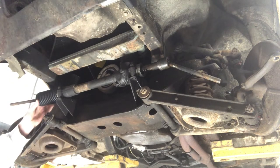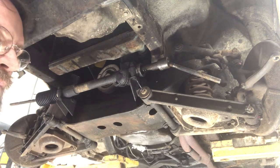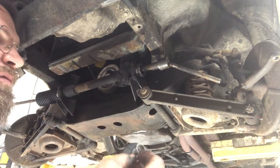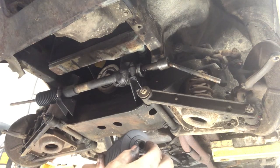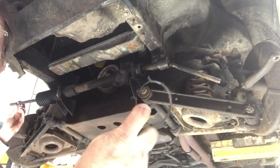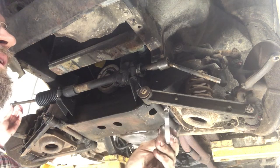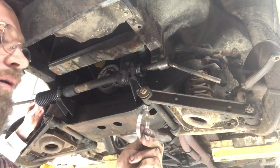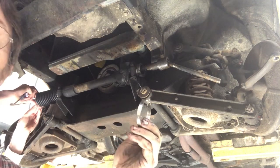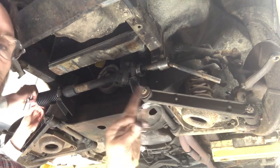The new ones can come with a variety of different clamps over the years. Sometimes the clamps are the same style but maybe a little wider — in this case on the end here, this is actually a fuel line clamp for a fuel injection hose. It's just a little bit wider, so you've got to play with that a little bit when clamping. The bigger clamps are apparently no longer available, so they're giving you worm style hose clamps nowadays. This changes every year — next year you might buy a set and have the right style clamps again. There's been times I've seen them come with just zip ties. So I always suggest doing your best to preserve the original clamps because you may end up reusing them.